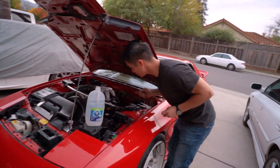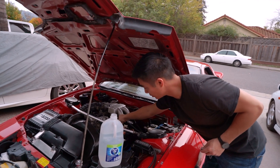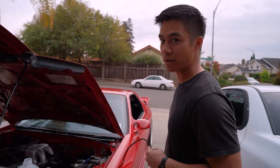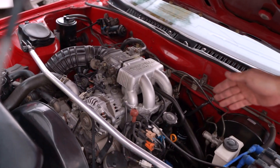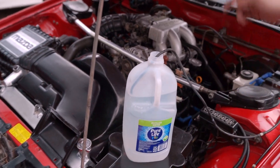When you're doing this, your exhaust is going to get hot — the cat and headers might glow, so just keep an eye out for that. Your car will also blow out a lot of steam out the back, so be careful with that too. Make sure your neighbors don't think you're blowing something up. So here we have the front rotor intake manifold going into a gallon of water. Get to about half and then we'll stop and do the other side.